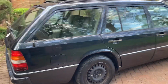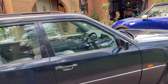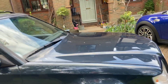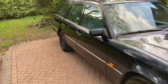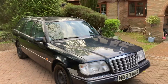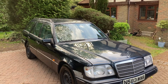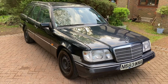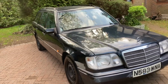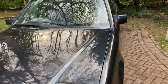What he did find was the air conditioning compressor had a bad pulley or clutch on it, and it was just making too much noise, so he's disconnected that, although he's left it in place so that the universal belt still pulls the pulley. And I'm going to have to get a replacement reconditioned air conditioning compressor, but that was not needed for inspection,